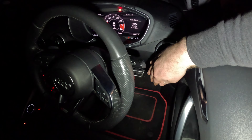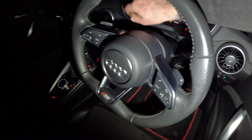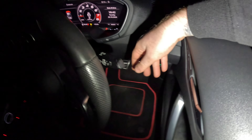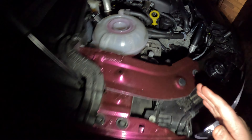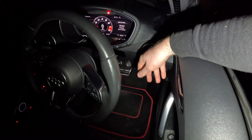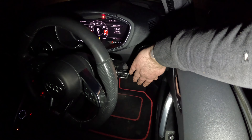The heater is boiling now — that means we've got circulation; if there was an air lock it wouldn't heat up. The temperature dropped back to 90 when I briefly turned it off. I'm leaving the cap off a bit longer until it starts to bubble slightly, then I'll put it on. Once the heater gets hot that normally confirms it's circulated properly. If the heater stays cold you're going to overheat — but it's boiling now so we should be all right.